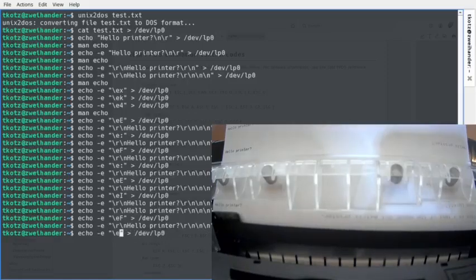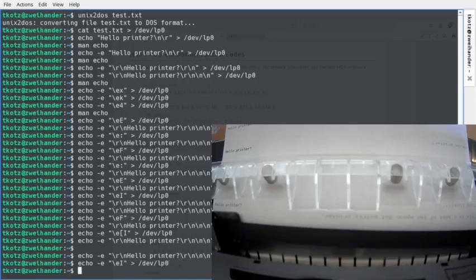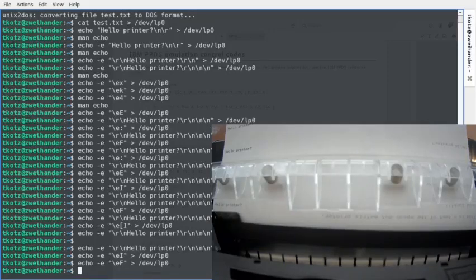So let's see. Escape. That did nothing. Oh, it did actually change the... It says it's sans serif now. However, I think I messed something up because it's no longer responding at all to being told to print stuff. It's not even doing its little line feed things. I'm going to hit the reset, which is tear off and line feed at the same time. So it's now reset. Now let's just try sending our print command again.